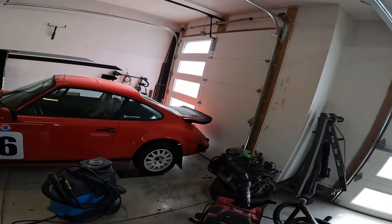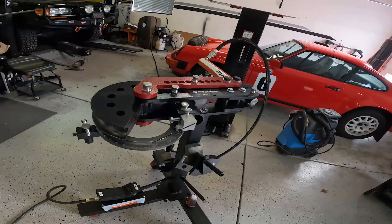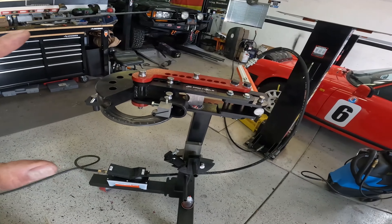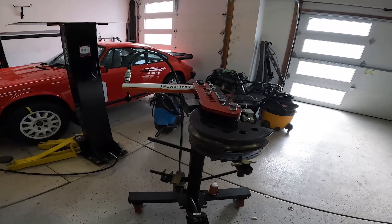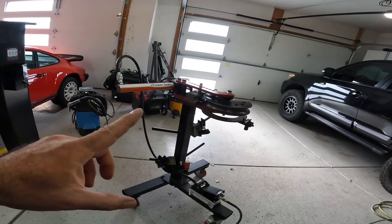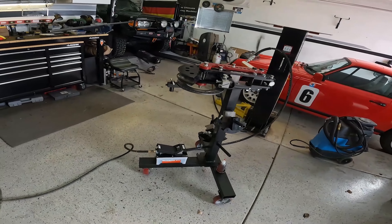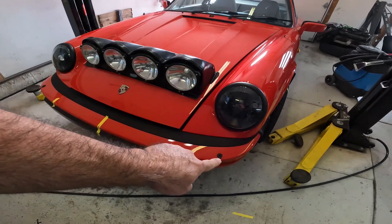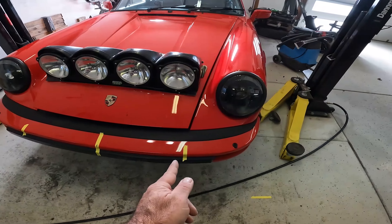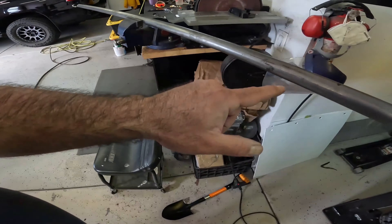We're back at another day with the Porsche. Got the seats in today and the interior is done — everything turned out really, really slick. Today is exciting because I get to play with my new toy — the Pro Tools hydraulic tube bender. There is a difference between a tube and a pipe, did you guys know that? For years I had my trusty Harbor Freight pipe bender and I was finally able to buy a tube bender and get some dies. I made this stand for it. So what I'm doing is building a little bash bar. I've marked out the center point and these points which kind of match that hood line — I want to start going in just about 15 degrees.